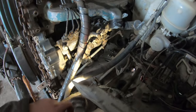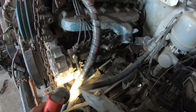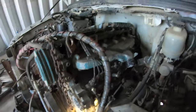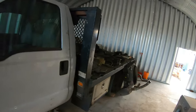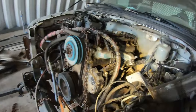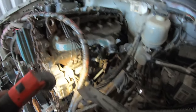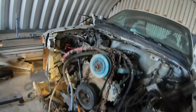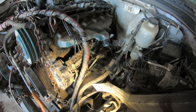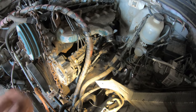On a DT360 you don't need a lift pump — it's got its own pump on there and it draws from the tank. I wouldn't have your tank too far away. On the International the tank is right at the rear of the engine on the side. So if you have a long truck and your tank is way at the back like mine, make sure you have a really big fuel line so it has a nice easy draw all the way up. A lift pump couldn't hurt — it helps with priming. It does suck its own fuel up so you don't have to worry about a lift pump if the tank is really close. I don't have enough experience with it to know how close you have to have the tank before you're having issues. The harder it is to suck through the hose, the harder time it's going to have, and it'll probably reduce the life of the pump. If it's a nice easy draw the pump will probably last forever.